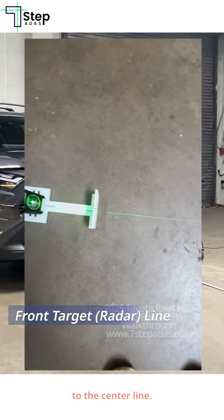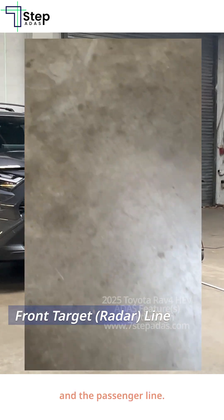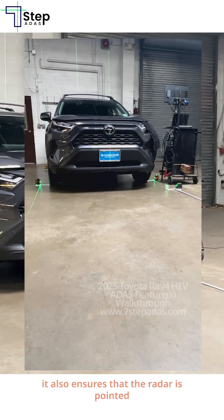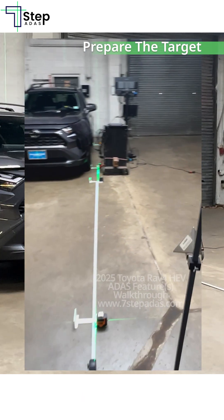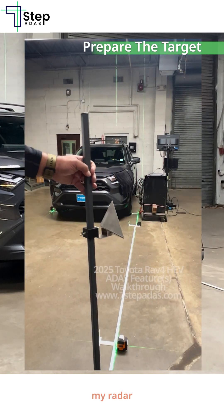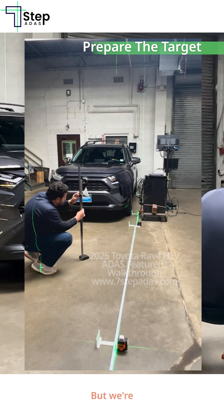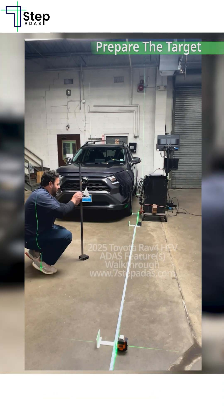The center line — perfect X — and the passenger line. The reason for the passenger line is for the camera system; it also ensures that the radar is pointed directly at the emblem. Now I take my radar and my ruler and measure out 850 millimeters — 850.1 is impossible, but we're going within the realm of possibilities. Now I have that set.